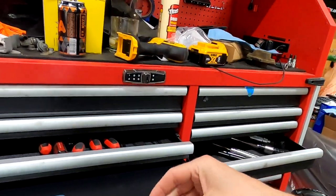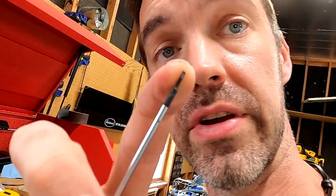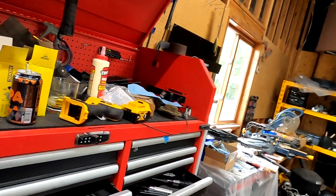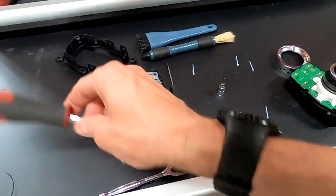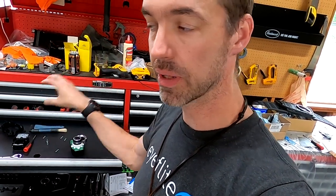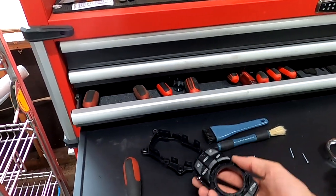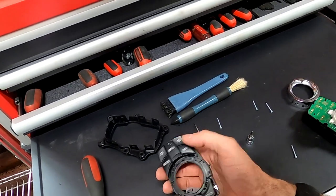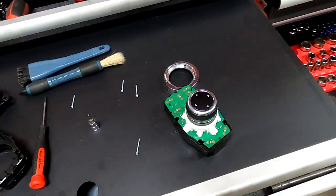You've got one little screw here — it's a T9. You need those for the back screws. I have here the smallest screwdriver in the history of mankind — it is a flathead, not a Phillips. I ended up not needing the ratchet. There are a hundred other videos out there showing you how to get this out and replace it; I'm going to show you how to repair yours. A previous owner had pretty much spilled something — the menu button just wasn't working. So I took this thing apart. You can see there's a whole lot of parts and pieces, but let's break this down.